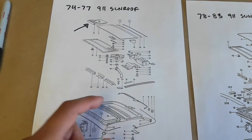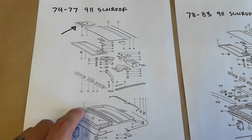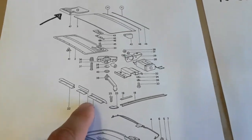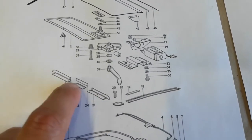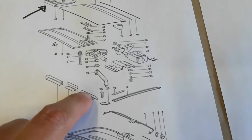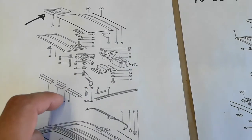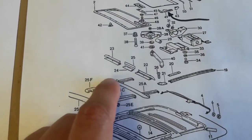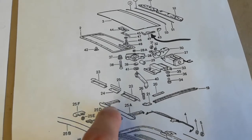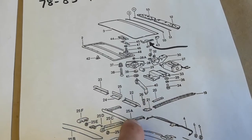The way the sunroof works: the panel rolls back into the roof cavity, and at the leading edge a spring-loaded wind deflector pops up to deflect wind from entering the cabin at highway speeds. The style I have is made of three pieces that screw into the roof itself. The hinge has a spring mechanism so the sunroof literally crashes into the deflector, flips it closed, and when it opens it pops back up again.